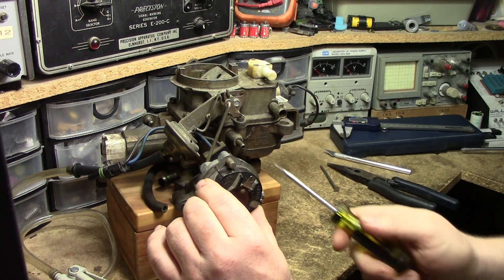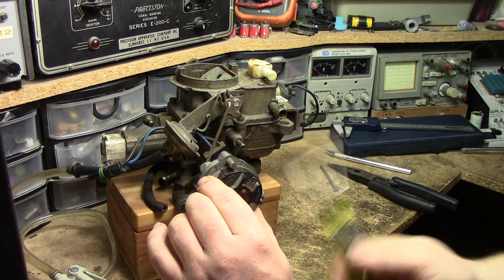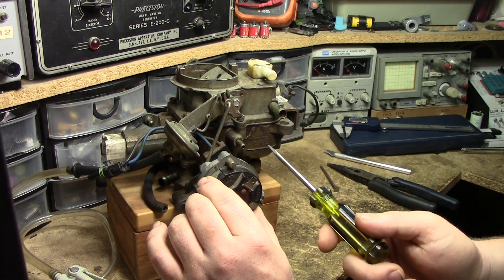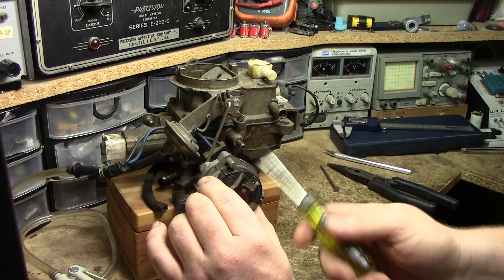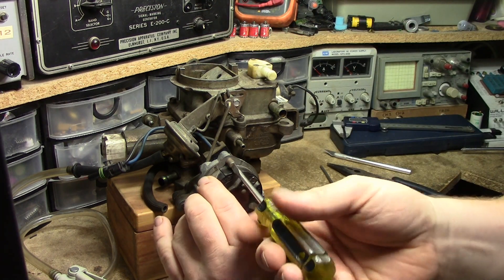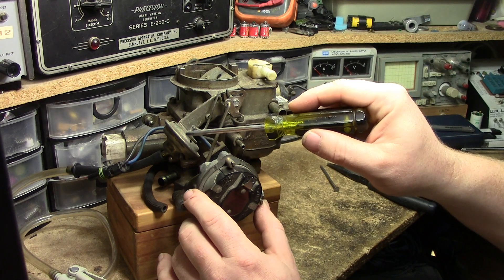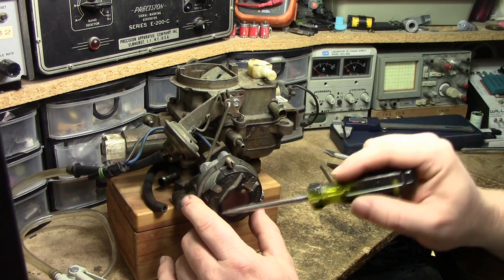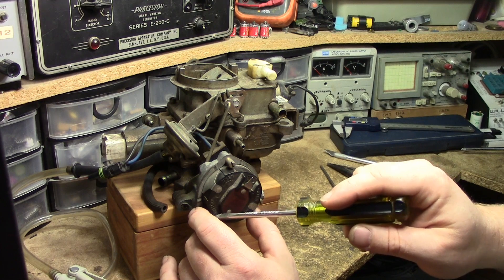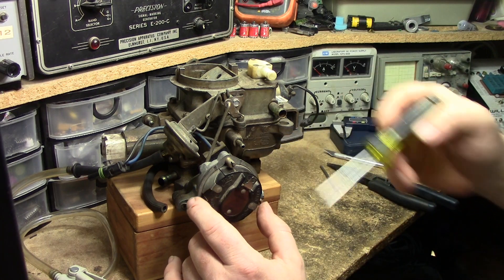I just started to see it cracking open there, so I'm going to turn it back a little bit, give it a tap. I have to use my finger to push it closed, give it a tap. I'm just going to watch that again as I slowly turn it — and about right there. So I'm going to tighten the screw. At this point, we have now zeroed out the force of the diaphragm and the internal coil spring, which can be in different places depending on your climate. If you're working in a cool garage it'll be in one position; if you're working in the middle of summer in California, it could be in another. So we just want to find that zero point, which is the average ambient temperature.